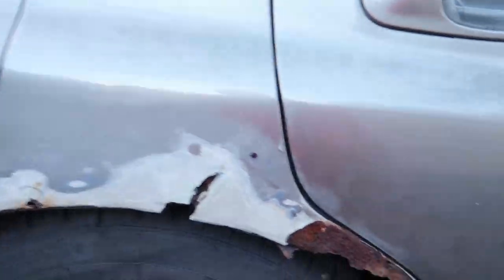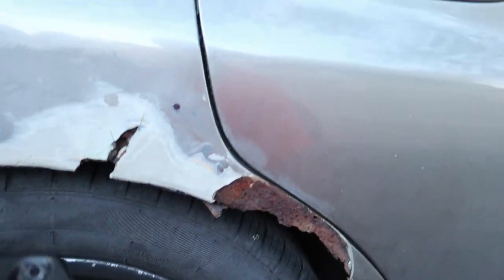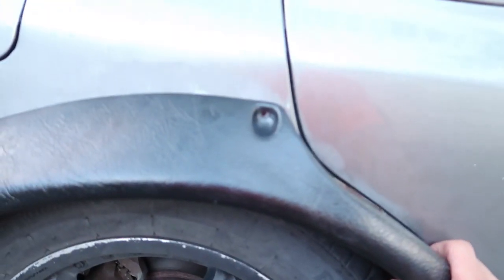I'm happy with the way the fronts are now. After I heated this one up and bent it a little bit, it's a little stretched right now but it looks good, so it's just going to stay there. As for the rear, I know it's not going to fit — I can keep trying to bend this but I'm always going to have that gap in the back. I thought about cutting them and putting everything on the door piece and putting the door pieces together so when it closed it filled in the gap, but it didn't really work out. I'm thinking about taking a weld nut and putting one here so I can drill through and hang this and then manipulate the rest of the flare.